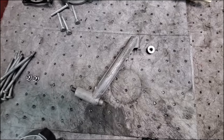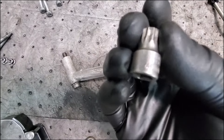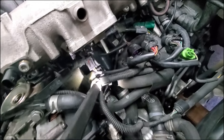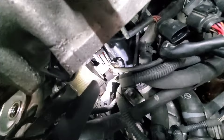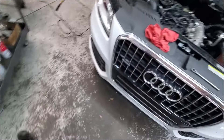Let's get all these bolts out - I just got them all cracked loose. This part might get some of you: there's a 13 millimeter that goes up into the intake and it goes to the block, and it's a triple square - triple square 10. It goes from there where the 13 is on that stud, and then down here where that bolt hole is. You just need an extension. The triple square socket is the unique one - it's basically a 12-point torx, also known as a triple square because the square has four sides and three of them is 12.